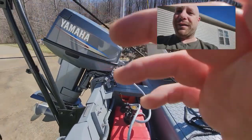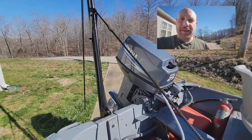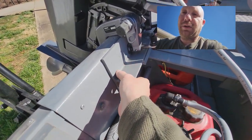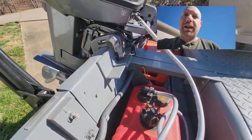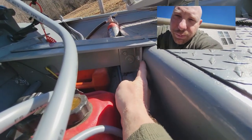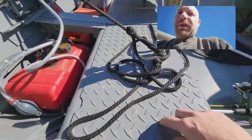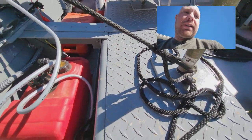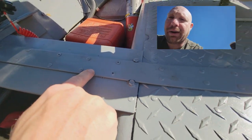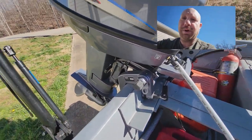Coming back now, we have the Yamaha 25 horse two-stroke — it's a 2005 model. To ensure that it can handle it, we have heavily reinforced the transom with an aluminum I-beam basically cut in half. That is anchored to another aluminum I-beam, which is then bolted to the seat both on the side and the top. There is a diamond plate support that runs across the top of the seat that is riveted in, and an aluminum strap here with rivets all the way down it on both the transom part and the seat part. That has really, really sturdied up the transom.